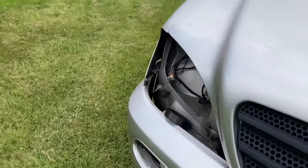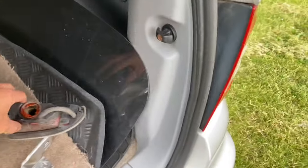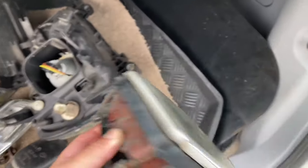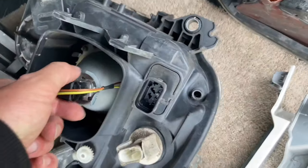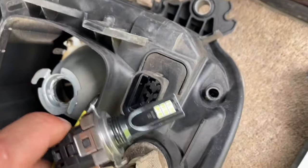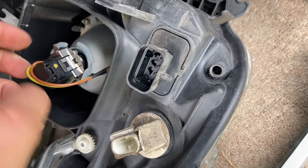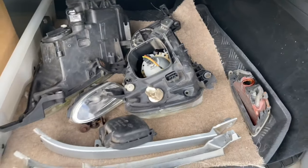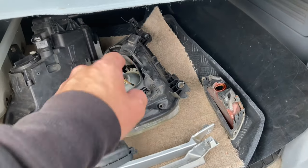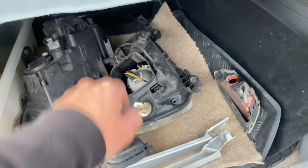For people in the ML Owners Club: you've got to use a little clip back there — you push the screwdriver through and push it forward and it pops the light out. To put it back in you pull the grille back, bring the little lever forward and it secures the light. The two headlights are out — what's been fitted are rubbish H7 LED bulbs, literally the light on your phone is brighter. So I've got H7 Nightbreakers ordered for the dip beams, H7 Nightbreakers for the fog lights as well.